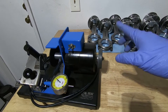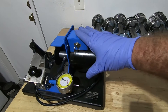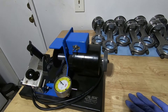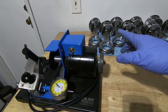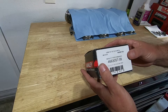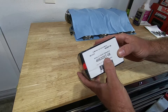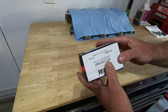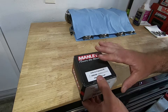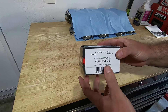In this video I'm going to be installing the piston rings on our pistons and filing them. I'll use the Total Seal ring filer and discuss some basics of filing rings correctly and how to put them on the piston. The rings I'm going to use are Manley, provided by Total Seal — Total Seal makes these rings, Manley sells them. The part number is 46630ST, these are 30-over and they're steel. The stainless steel ones are good; I recommend them for any type of boosted application or high horsepower stuff.